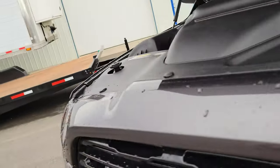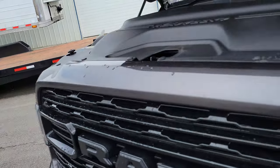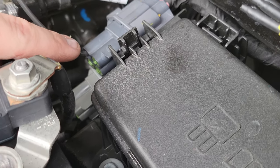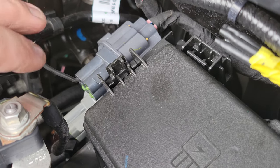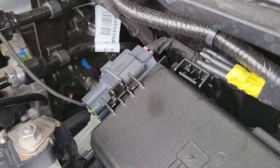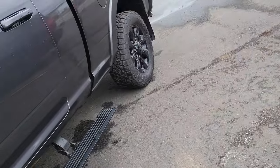I'll be using that trailer in a couple of days — it's gonna be a pretty cool video, I picked up a project I'm excited about. I got me some auxiliary switches. This is a button — it's currently set to battery, but I'm gonna change it to ignition in the speedometer settings so it can only run while the ignition is on. That's just one hot wire, and then you ground the negative to the frame.